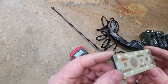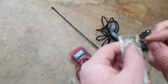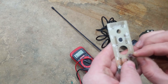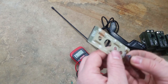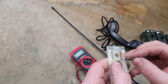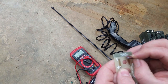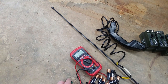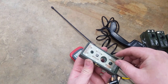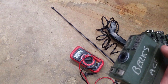With that in mind, let's see about cleaning out these contacts a little bit. We'll give each one of these little posts a little bit of a rub with sandpaper. Maybe some contact cleaner would work too, but this is what I've got handy. I'm not really taking any material off - just giving her a little scrape to get rid of whatever gunk might have accumulated over the 40-plus years this thing has been used. Let's put it back together and throw that spare fuse back in there. Turn that post and reassemble the battery.